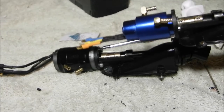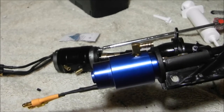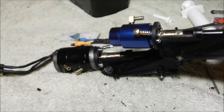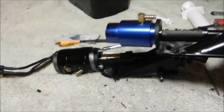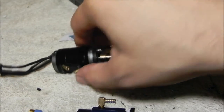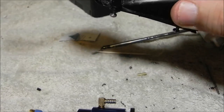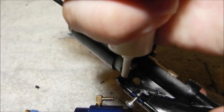Now let me say one other thing about these motors. This motor here is good — you can run it at 2S LiPo and it runs fine, but it is less efficient than this other one. This motor here actually runs longer and runs cooler. I recommend running a better ESC with it. This motor draws more amperage in most situations than the other one. This one runs at higher voltage, lower RPM — same watts. This is about a 600 watt motor, and that's probably about a 150–200 watt motor. This is a much better motor and probably the way you'd want to go.